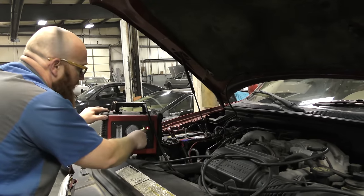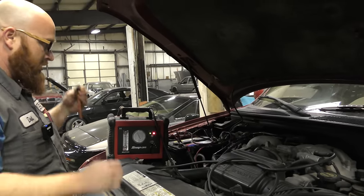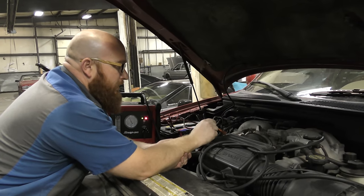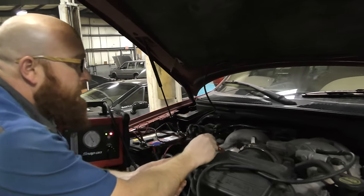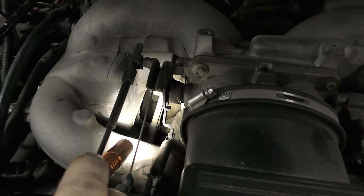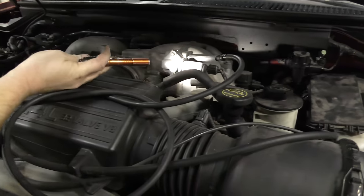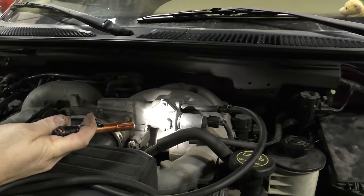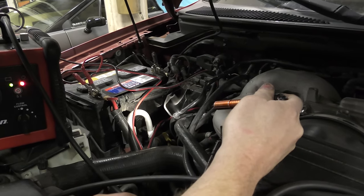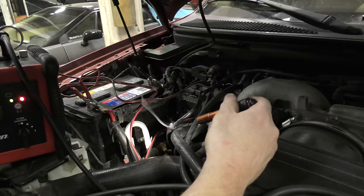You can take the ductwork off and plug it so it doesn't fool you, but I never mess with that. Without too much trouble, you can really track down some intake leaks with this. Let's say it was running rough and we suspect a vacuum leak. You let it fill the intake up — it takes probably a minute. You'll look where the intake manifold actually bolts to the cylinder heads and start looking for wisps of smoke. We're seeing one there — that's normal, that's from the idle air control valve. I did this on purpose so you could see the smoke. If that would be in a cracked vacuum line, we'd have our answer.